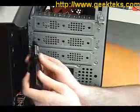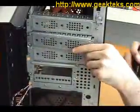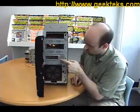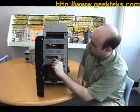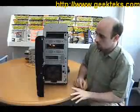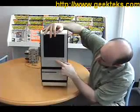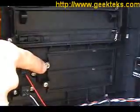This case is a bit unusual because it's got screws that hold in these plates over the external drive openings. You'll notice there's no plate covering this 3½-inch drive bay — that's because when we put the computer together the first time, we lost it. It looked a lot like this plate right below it. If you're opening your case for the first time, just grab it and wiggle it back and forth and it'll eventually come out. In the meantime, we need to remove this door covering from the front of the case, which we'll do by unscrewing the screw right here.